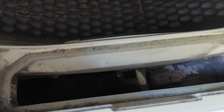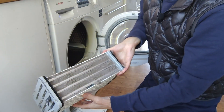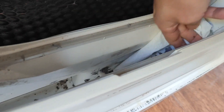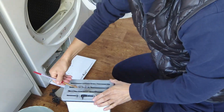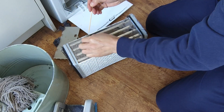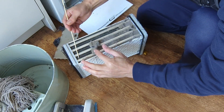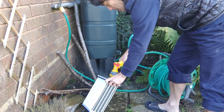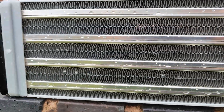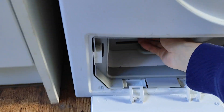After this, I decided to look at the airflow system and heat exchanger, and found these. This sludge was accumulated in the sump. Maybe I should have done that cleaning before doing any test. The heat exchanger was completely blocked by fluff — no air had a chance to go through, either side or through the vertical. So I did a deep clean: washed it by hose, put the heat exchanger in water for a couple of hours, and cleared away all the fluff. Also cleaned the intake duct on the front cover. Then put everything back.